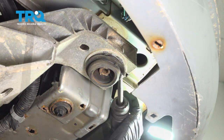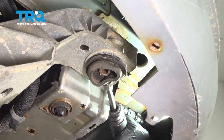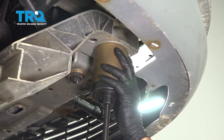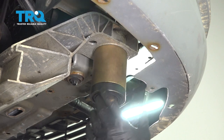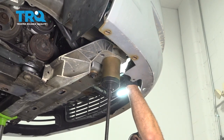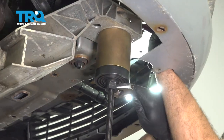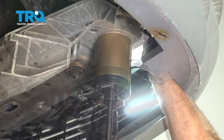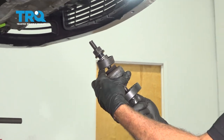Work it from the other side again. What we did was use the air hammer or air chisel to roll back the flange around the mount itself. Now we're able to put the puller tool on here and continue pressing that bushing out. At this point we're able to push or press out the bushing completely.